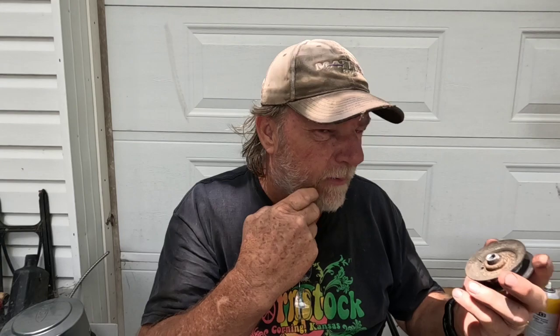All right, now back to talking about replacing the pulleys. These are the pulleys for the ground drive that drive the wheels, and this one here is super quiet. I'll hold it by the microphone. I think this one's probably been changed. But then this one, I don't know if you can hear it, I feel it more than I hear it, just the roughness in the bearings. And when you let the brake pedal out and it tightened the belt, it really howled. It was very noticeable.